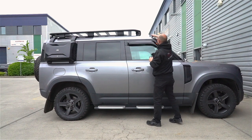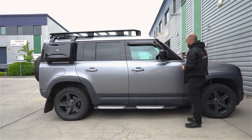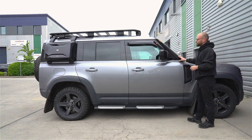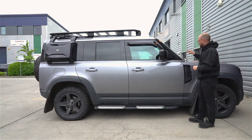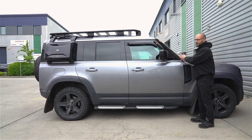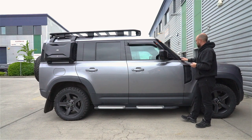When it gets to this point, you're tucking the cable all the way in and then you get to the A-pillar trim. The A-pillar trim is easily removed on the outside of the vehicle — you take this trim off, there's a T30 screw underneath, and then the whole thing slides down and pulls away, and then you can again hide the cable in there.